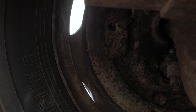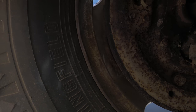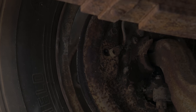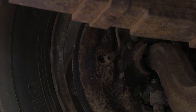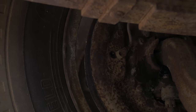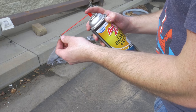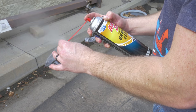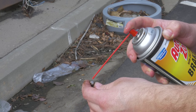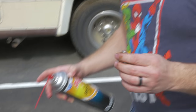When we go around and bleed all the brakes again, all the rest of the junk that's in it will be gone. I'm going to try and clean the front brake bleeders out now and hopefully this thing starts braking again. You can see that — let's see if I push the brakes. We're going to bleed them all anyway, so I'm not too worried about getting fluid right directly in my face. Anything? Nope, nothing. You might have a more serious problem there. See, it's not coming out of here — that's the problem. Let's get some of that nasty gritty stuff coming out. I'm going to have to soak this one — yeah, that's clogged.